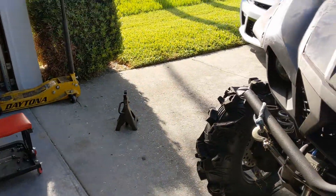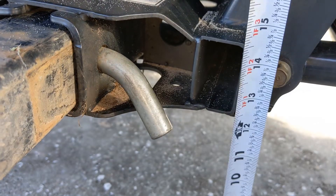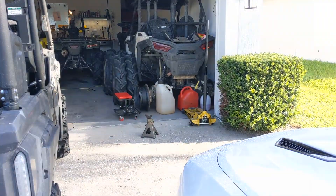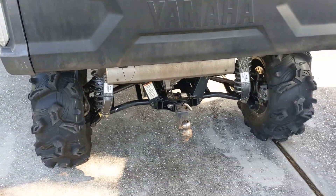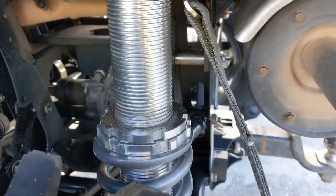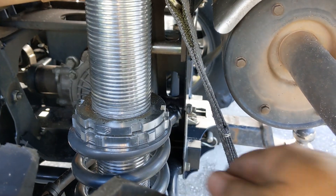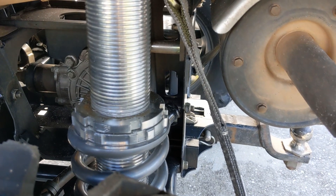I'm gonna get the tape measure out and show you the ground clearance. Up front, about 14 inches — pretty respectable for a family mobile. In the rear, twelve and a half. Not amazing — not the Razor, that's for sure; the Razor has that much clearance with just rims. I didn't set the preload super stiff. I set the preload as soft as I could get it — to where with the limiting straps at full down travel the spring had just a little bit of preload, barely hand tightened, not past that.